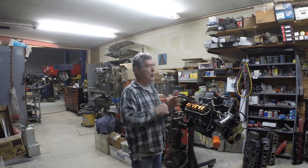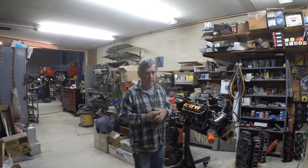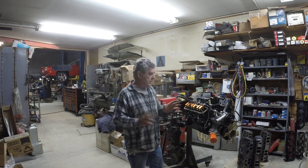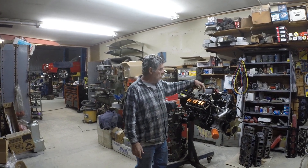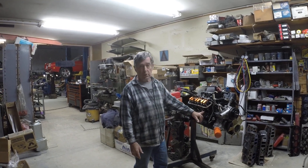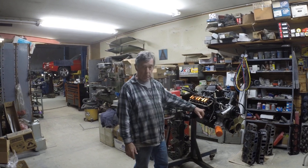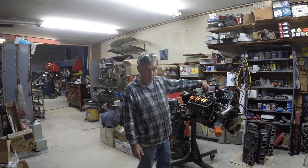They say you don't really have to touch it — throw a turbo on it, it'll blow it past. Well, yes, it will. But will it do it at 100% efficiency? Absolutely not. It's not possible. So what you do is you take the intake manifold — first off, you do your heads. You open up your exhaust ports so that even though it's being forced out, it needs more room to get more out because you're going to be putting a whole lot more in on the top.